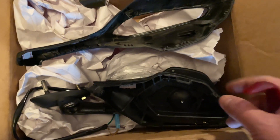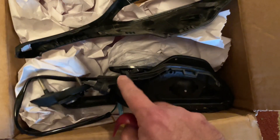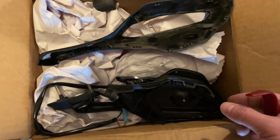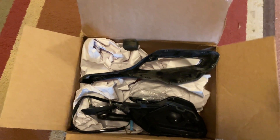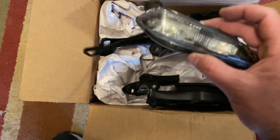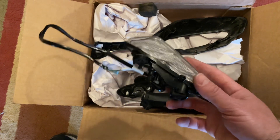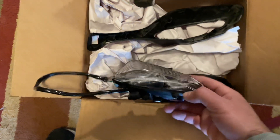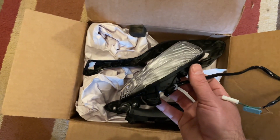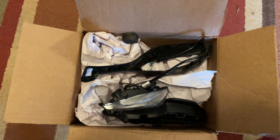It might just pop off as a hinge if you get the top done — it might pop the bottom off pretty easily. If you break the clips they're pretty tough; I broke a couple and when I snapped it back together it was just fine, not wobbly or anything. It's working great. The only reason I had to take it apart is because this thing was hyper flashing, and I don't know if it's a different part between the Double R and the Triple R. It might just be something wrong with this module. Bye.